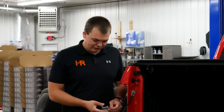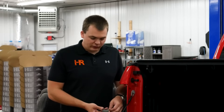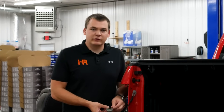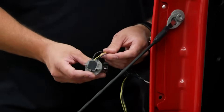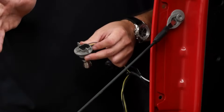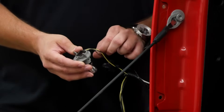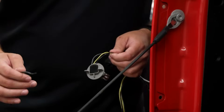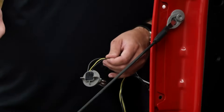If we look at the socket on this particular truck, you're going to find that one wire is ground, one wire is going to be parking light, and one is going to be turn signal. On this 3157 socket — which is a super common turn signal bulb socket — these outer two wires are your ground and your turn signal. As long as one wire from the resistor goes to ground and the other goes to turn signal, you're not going to have any trouble.